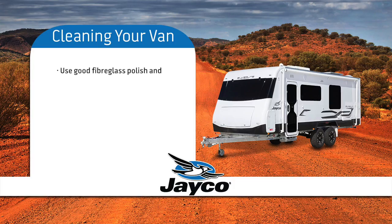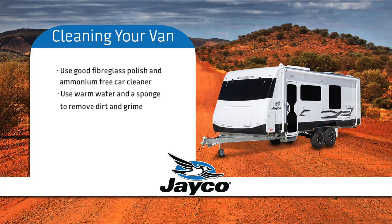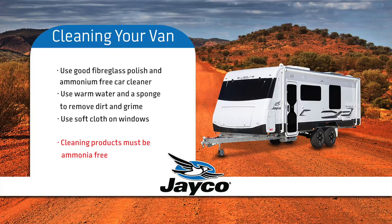Using a good fiberglass polish and a car cleaner that does not contain ammonium, use warm water and a sponge to remove dirt and grime, and in most cases warm water will be sufficient. A soft cloth needs to be used when cleaning the windows to prevent scratching. Once again, please remember, cleaning products must be ammonia-free.